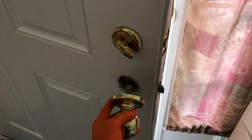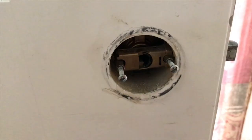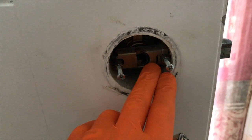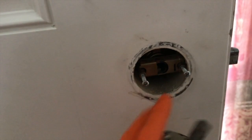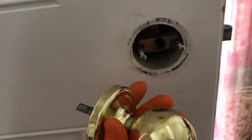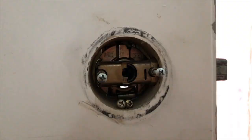At the door now — all I did was turn the knob in hopes of opening the door and it fell off and landed in my hand. I grabbed a flashlight and we're going to investigate. Here's a closer look: you've got two Phillips screws that actually go into this portion here, and you'll notice the little circle cutouts right there and right there. Those are supposed to align properly and turn and lock on the Phillips screws. However, that's not working because the opposite side is extremely flimsy and loose.